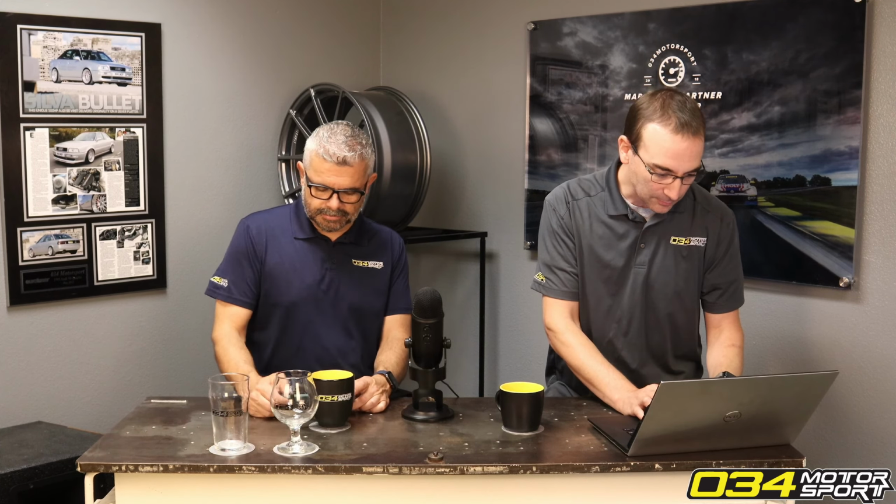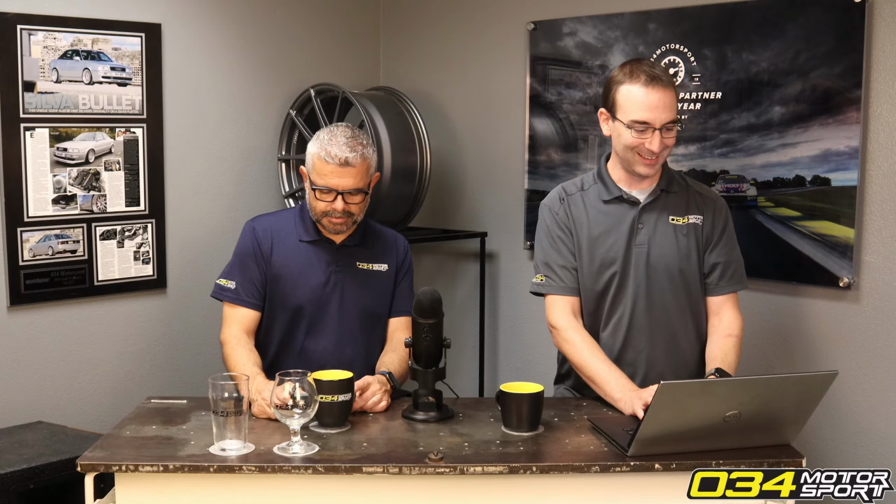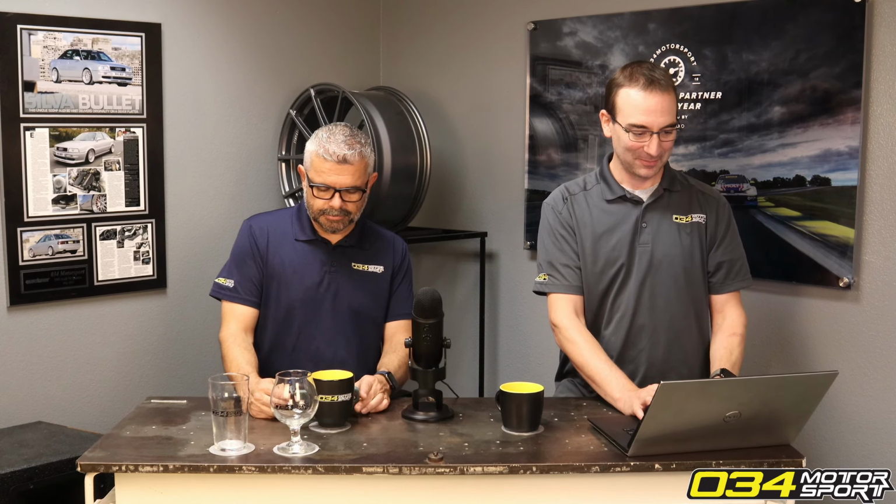You have to be careful what exactly you're coating. If it's a turbine housing for a turbo, coating the inside can be rough, because some of those coatings, depending on what they are, can actually break up and go through the turbine. You have to make sure it's a good quality coating and it's been applied properly if it's going to be put on the inside. Generally not the kind of thing you want to do at home. But I do see people do that. It's a good way to reduce radiant heat.